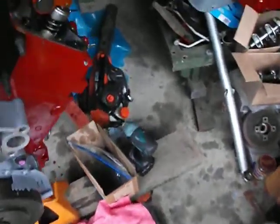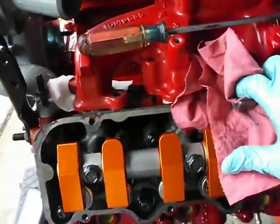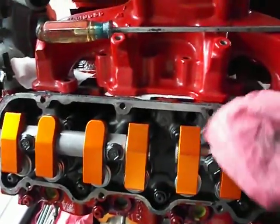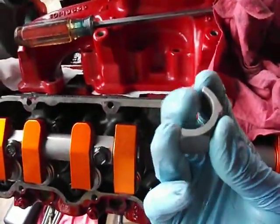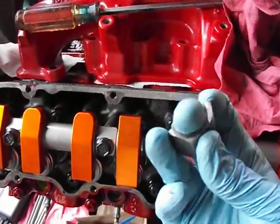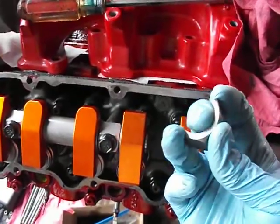The thing's already getting too hot for me to handle, so I'm going to cool it down. Then wipe it off real good with a rag. Before you put that back on the shaft, before the final assembly, make sure you get any burrs or anything off of it. You could take some emery cloth and just smooth up the grinding, because you're going to have an edge that you create. Right here on that surface you're going to have a little burr right where my finger is, so you want to get some emery cloth and knock that off.